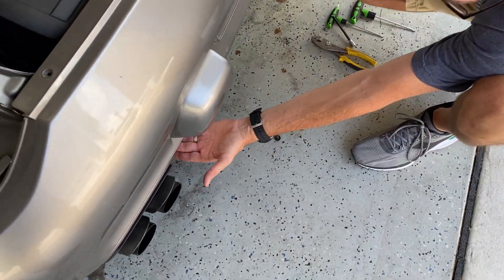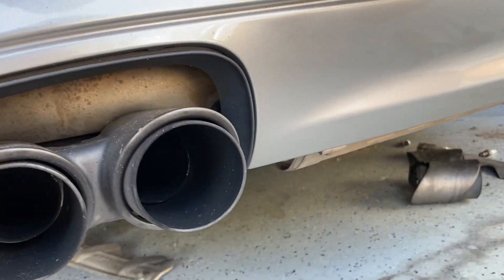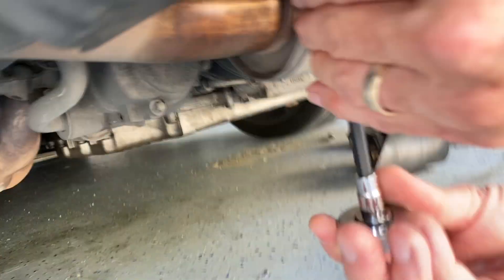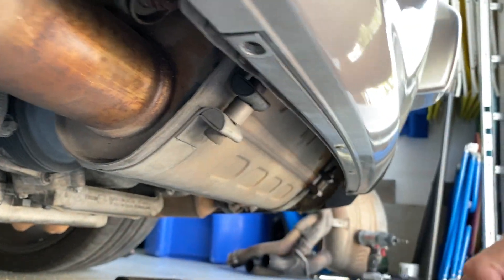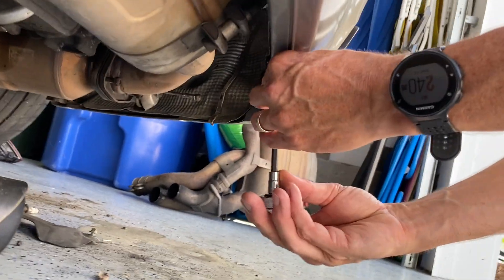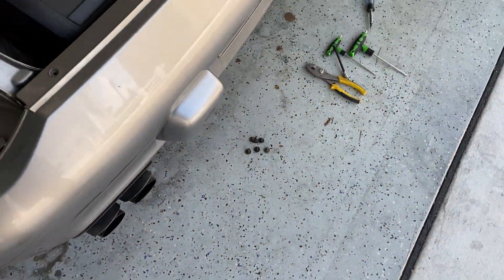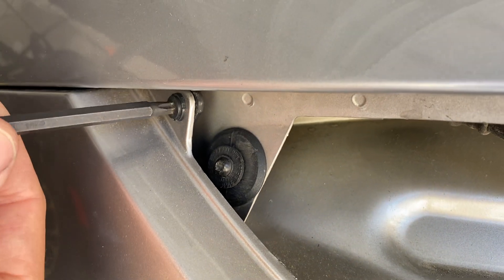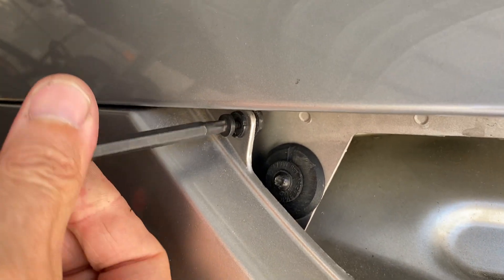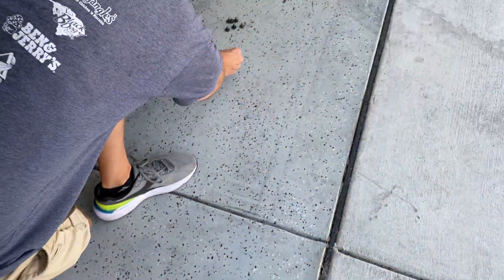On the bottom side there are two fasteners, one by each muffler. I've already had the car apart and one of my mufflers is off — I'll show how to take those off in a subsequent video. There are two here along the bottom. Then on the side of the car there's one little plastic press-in piece. To get it out just reverse it out with a Torx bit and it should pull completely out.